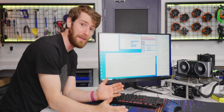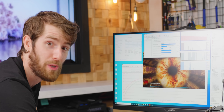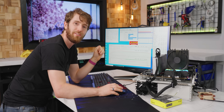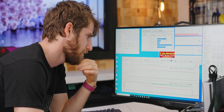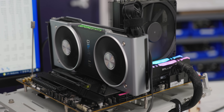Remember how one of the challenges for an SSD sitting right between the CPU and GPU is that when you're gaming or doing anything intensive it could heat up even more? We're going to run FurMark and try again. We peaked at 79 degrees and definitely thermal throttled — we went from almost two gigabytes a second to one gigabyte a second reads. Hypothesis proved: a GPU being nearby is bad and it can cause thermal throttling.